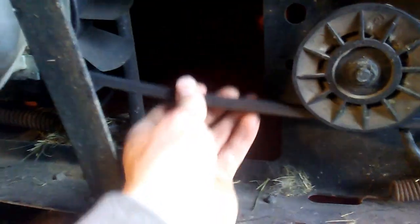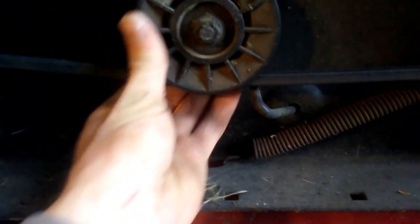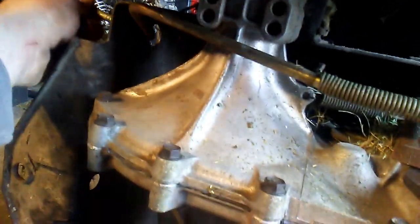30 cartloads of dirt. And after that, the transmission got really loose and really lax. And I'm guessing what happened is I stretched my belt out from too heavy usage. So I'm going to put it back into drive, out of neutral, by pushing that in. See, the belt does feel a little loose. I'm not entirely sure how these drive systems work, but well, let's see how I can get this belt off of here.